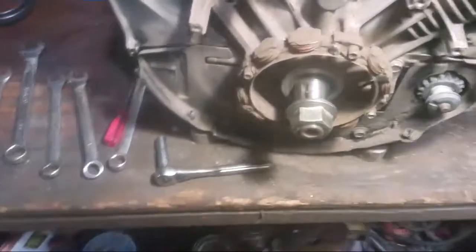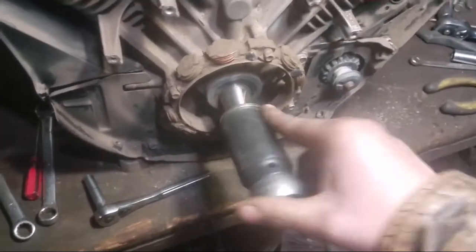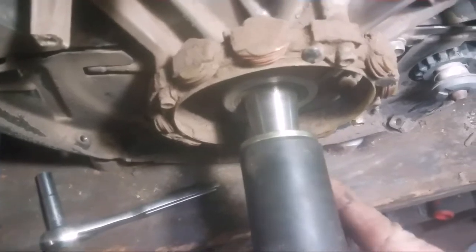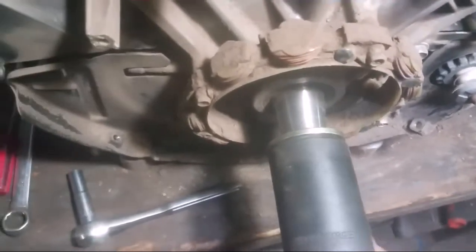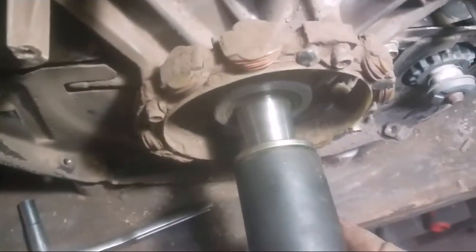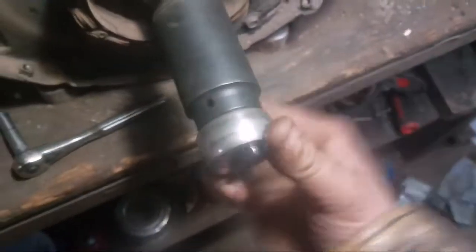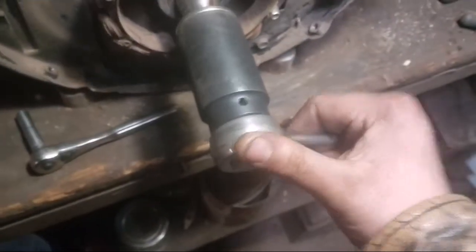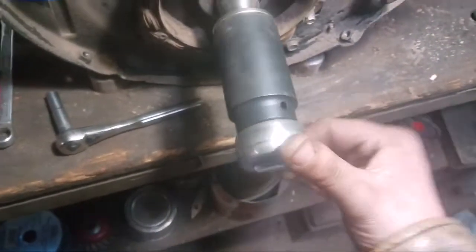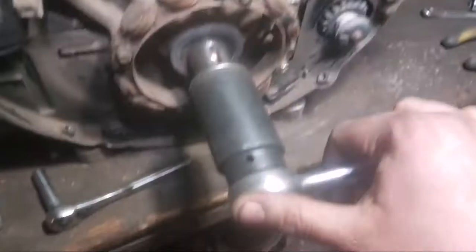Another thing I did while I was in here is I started spinning this by hand. Like I'm putting a good amount of torque on that. I don't know if you can see that bouncing back. But I'm just looking for some blow-by or leak down test, which this one's, I'm just past top dead center on the number 2 cylinder. This one's quite a bit better. This one's bouncing back pretty good versus the other side, which would be this side.